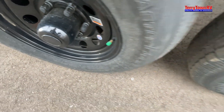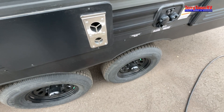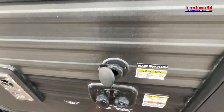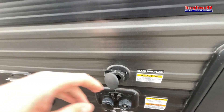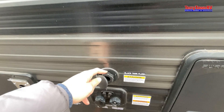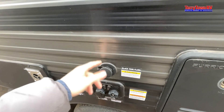Just underneath here, for your tires, the little green knob indicates that they are filled with nitrogen. You are able to fill them with regular air — the tires do not inflate or deflate with temperature change. Moving to the black tank flush — your black tank is your toilet usage, so toilet paper and whatnot. After you pull the black tank valve and it empties, go ahead and put a pressurized hose into the black tank flush port. That turns on a sprinkler inside the black tank which helps wash out anything that may have gotten stuck. I still recommend doing the black tank flush and then doing the grey tank last.